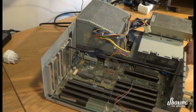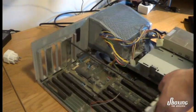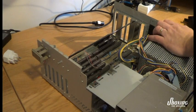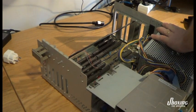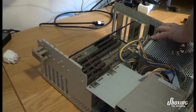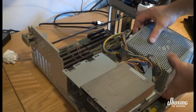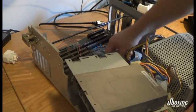This is my favorite computer, the Amiga 2000. It's a fine looking example except for some minor issues. It's working and we are going to make it even better by replacing all the capacitors in the power supply and cleaning out the floppy drive. There's also leakage from the battery that holds the data in the real-time clock on the motherboard. We need to fix this before it gets any worse. The most common problem with these machines is the battery on the motherboard.